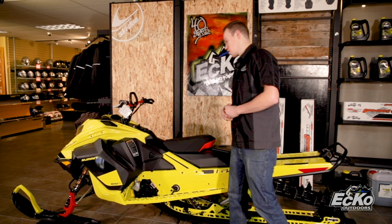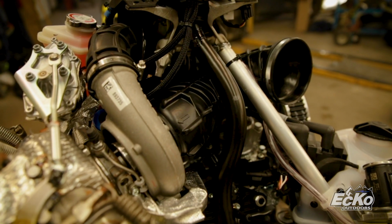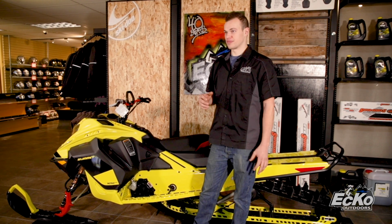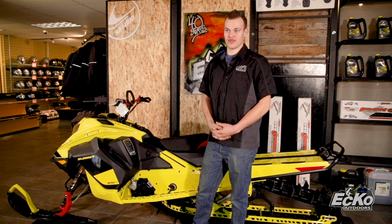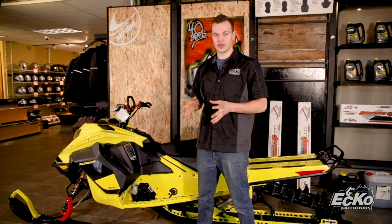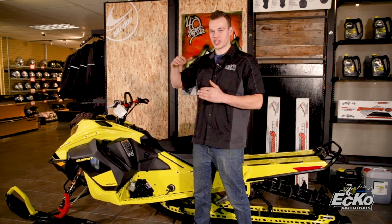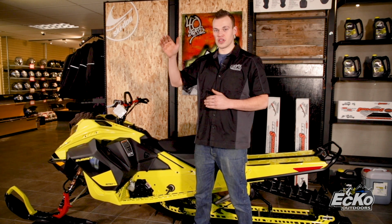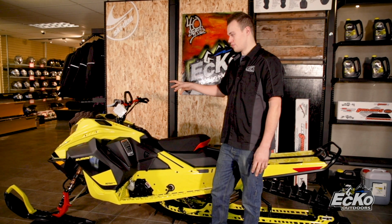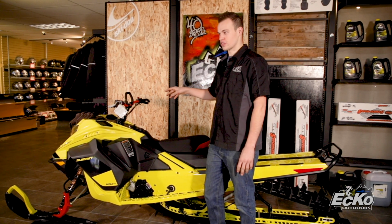all the way up to 8,000 feet. A lot of people don't realize this, but when you're at 8,000 feet on a naturally aspirated 850 Summit, you're losing anywhere from 30 to 40, 45 horsepower. So at sea level, naturally aspirated 850 has 165 horsepower. As you go up, that keeps dropping. 8,000 feet, you're down to almost 120 horsepower. Now this 850 turbo, 8,000 feet, 165 horsepower. That's what makes a huge difference.